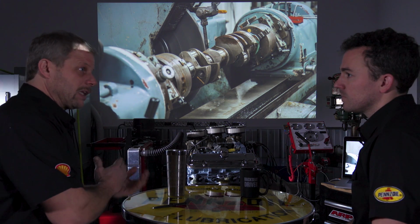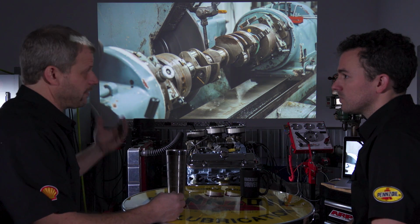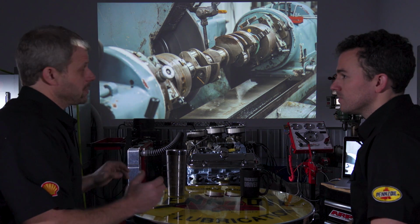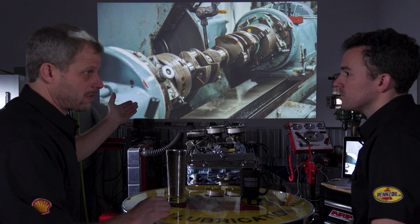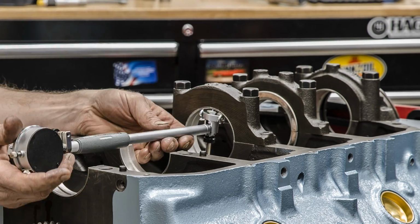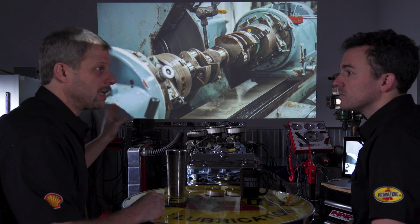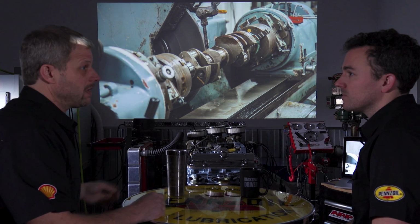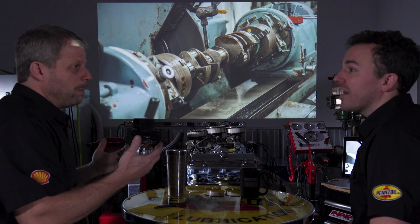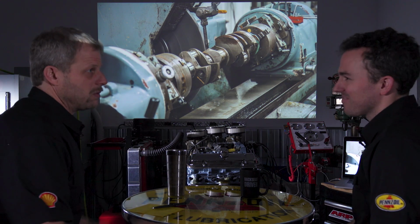So at the end of the day, you're trying to set clearances for oil. So you've got to make sure you have bearings to work with that to get the clearance to where you want. In this process, again, this is capable to go to the millionths, so you can set your clearance exactly where you want it. The best case scenario would be to take your bearings, say, all right, I'm going to cut this crank to 30 over. You take those bearings, put them in a block, measure everything, and then take that information to the crank grinder and say, okay, I want exactly 2.5 thousandths clearance. Okay. And he'll say, okay, cool, I know exactly what size I need to cut these to, and it will be dead on. Now, typical fashion is you send the crankshaft out, you get it cut 10 over, and then you go buy your bearings, and you're right there. Yeah, close enough. But if you're close enough, you're within a half a thou. So when you get into race type applications where things are really critical, that's where you would go and do it in that direction. Okay.